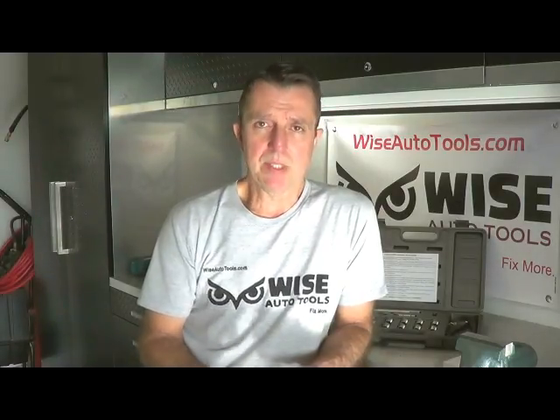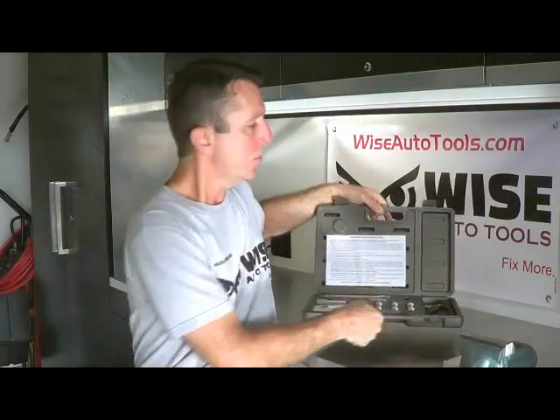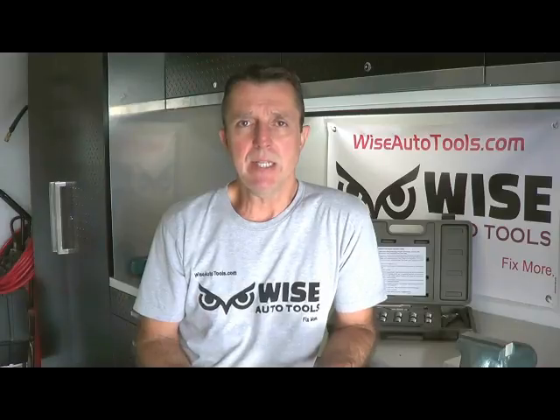The fact is, we've been selling the 38900 kit with the steel alloy inserts that it comes with. We've been selling these online since 2005. We've never had any ill effects from having a steel alloy as opposed to an aluminum insert. The steel alloy shares enough of the same properties that it heats and cools closely to the aluminum, and it doesn't have any ill effects from either a misfire or loosening up over time.